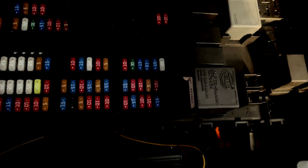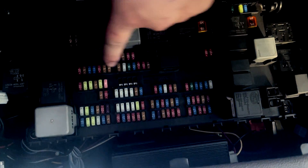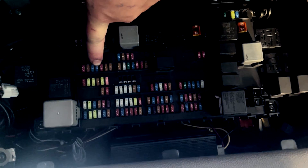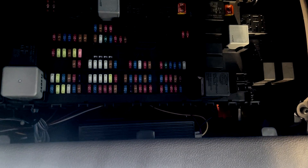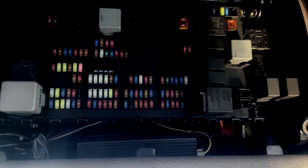Let's think of other fuses. ABS ones — there's one here, one here, and there's ABS ones here as well. Always check your fuses before anything, any electrical job — check fuses first. Because you never know: we've had a blue one blown here, done all the diagnostic work, and then found out it was just a fuse. Light fuses and these ignition relays are very common — always check them.